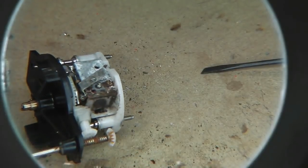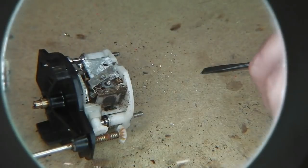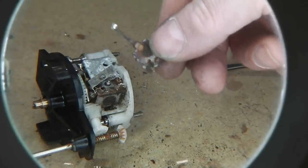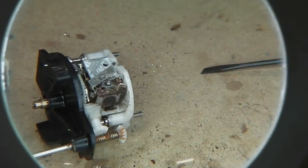So I've just taken the top off the little solenoid here. And that's the arm which flies back and charges the clock up and in the same time makes electrical contact, pushes the bobbin away. The inertia of the bobbin continues going and this flips back being de-energised.